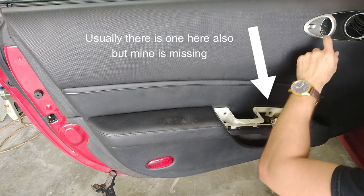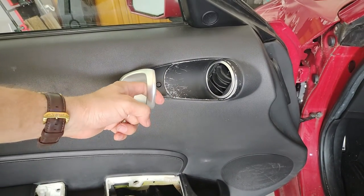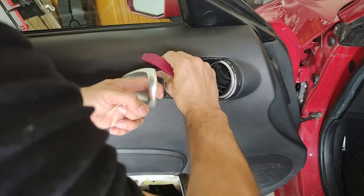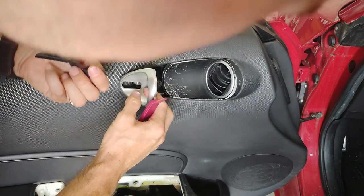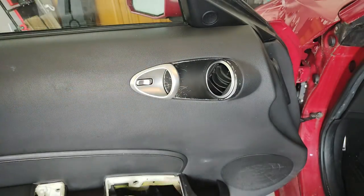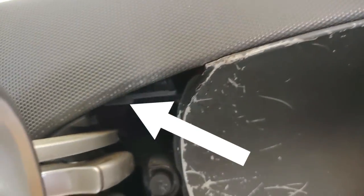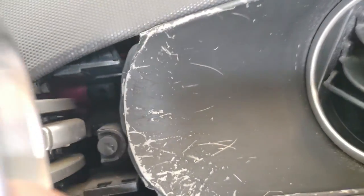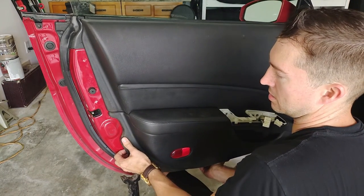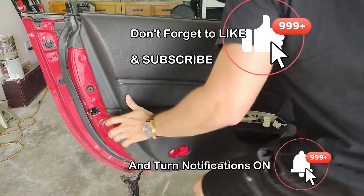There's that one, and you've got one behind here. You've got this little pole here — plastic trim remover tool, pry that, pop it out. Normally there is another 10mm bolt in there. You see that hole? That's where it's supposed to go, and another reason you need some extension on your socket. However, whoever has taken this door off in the past did not put it back. It just clips and hangs on — this one was barely on, doesn't give me warm fuzzy feelings at all.